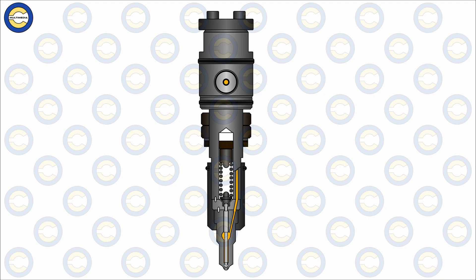As the pressure keeps building up and rises, it acts on the shoulder or tapered area of the needle. Once the fuel pressure reaches the set pressure or just slightly exceeds it, it lifts the needle. The set pressure referred to here is the calibrated spring tension — the pressure exerted on the spring by the compression forces applied via the pressure adjusting nut and lock nut assembly tightened onto the body.